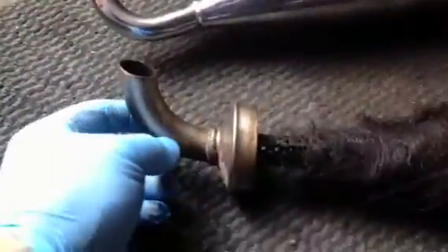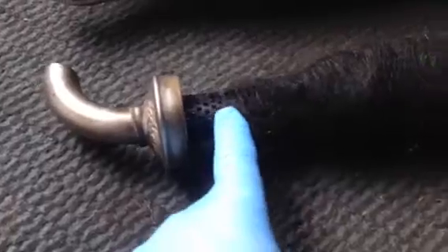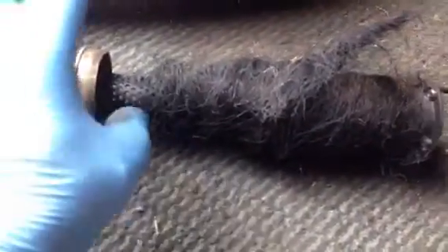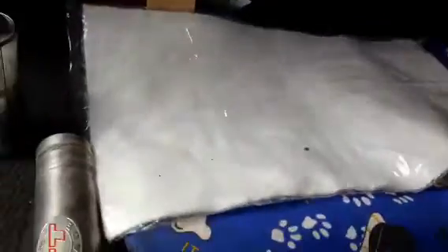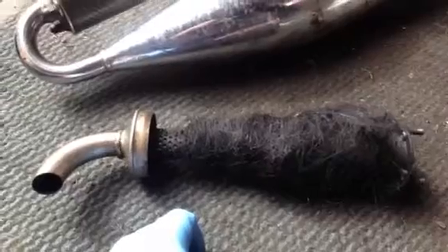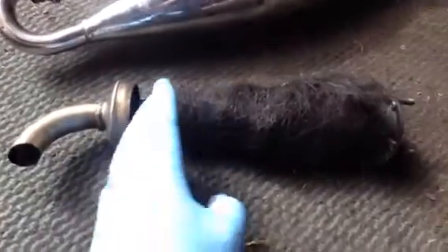The MOT station, depending where it is, will fail it. And this is what happens though — the wadding starts to push all the way down like this one has. You can see this wadding is knackered. It all needs coming off. Now, just because you repack it — this is the stuff you buy, seven or eight quid off eBay, brilliant stuff. Cut it to shape, wrap it round until it just gets under here. Cut bits of coat hanger wire around it; that will keep it in position. If you don't do that, it will do this again. This is the old stuff, and this is why it's so noisy — it comes in and just fades away, and you're getting no back pressure.